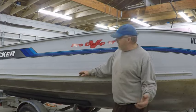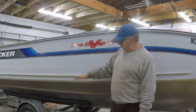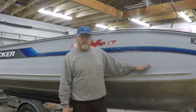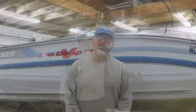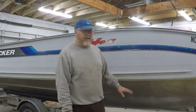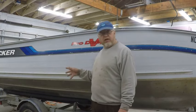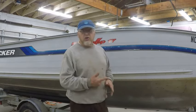Just do half of the boat at a time. Another thing you can do is jack one side of the trailer up about 6 inches before you block it. That'll tilt the boat up enough so when you fill the water up it only covers half the side and you can get the water a little higher on that side. But don't try filling the entire boat up all at one time. Today on this nasty dreary day in the Carolinas, I'm going to put all new bucking rivets in the ones that are bad. I marked all the rivets that were leaking, and now that I know where they are, I'll go ahead and drill them out and put new bucking rivets in.